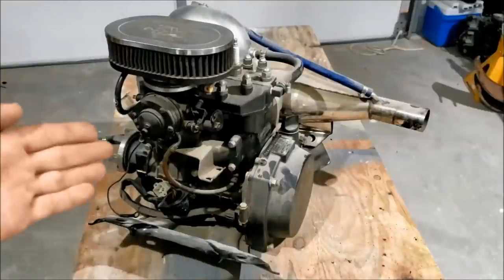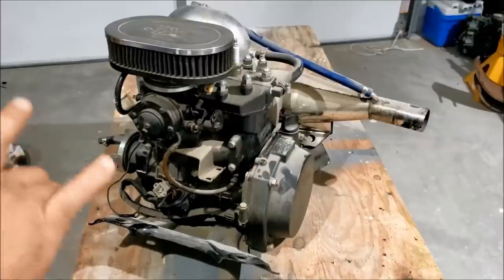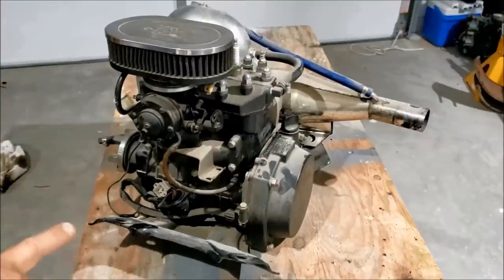All right, now it is time to work on the old motor. It probably doesn't need much. I probably put gas in it. Probably runs fine, to be honest. But might as well clean the little carburetor. It hasn't been done in decades. The other problem with these things is the seals on the crankcase can go bad, leading to its inability to pump and suck fuel.